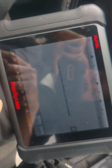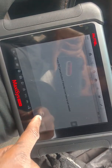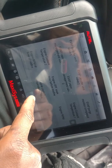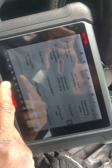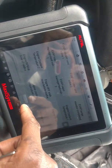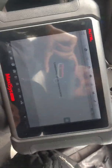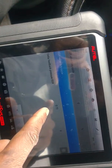I'm going to cancel and check the live data — I want to look at the DPF-e voltage if it's available. I wasn't seeing it at first, but there it is. Right now the DPF-e is sitting at 0.72 volts, which is okay at idle.